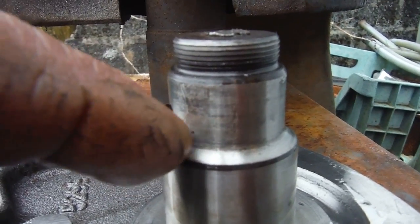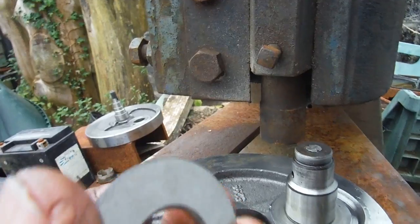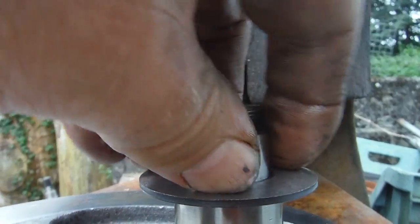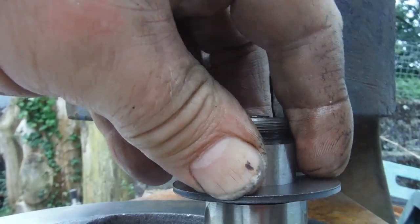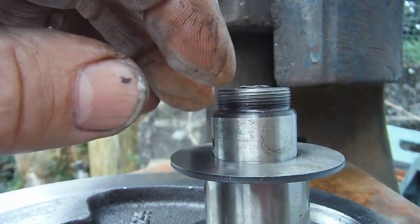There's a huge radius on the crank pin — a radius is a good thing — and there's also a bevel on the inside of the thrust washer on one side. But look at this: if I put it on, the recess in the thrust washer doesn't fully accommodate the chamfer or radius on the crank pin, and it can wobble about like that. That is why I've had trouble trying to true this one.